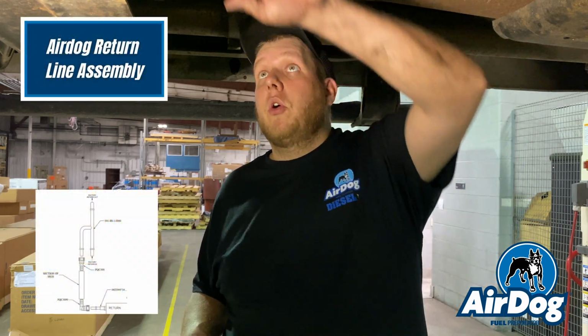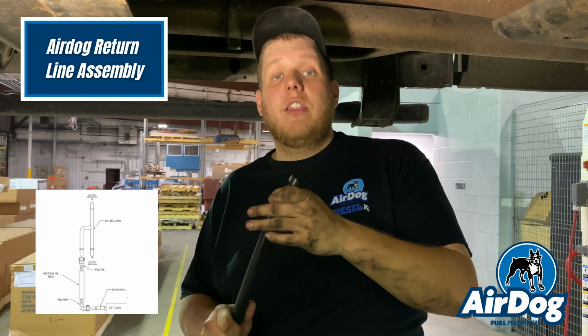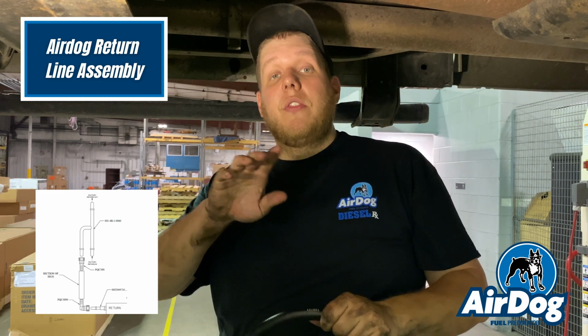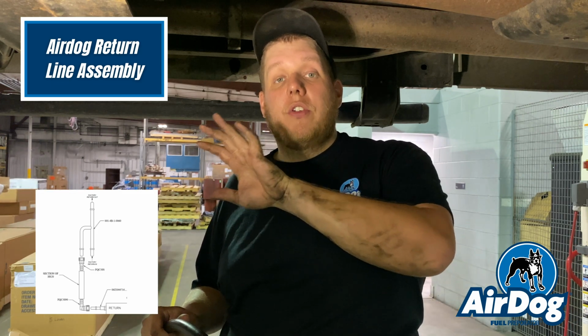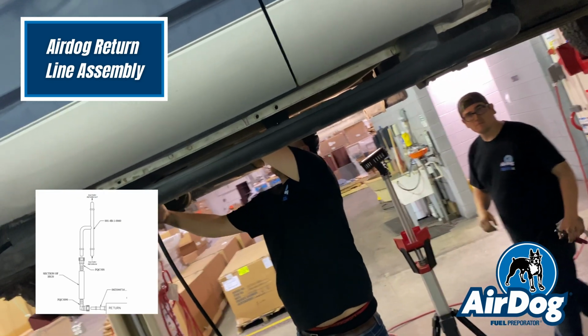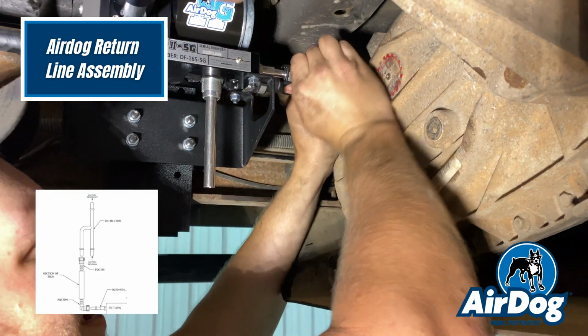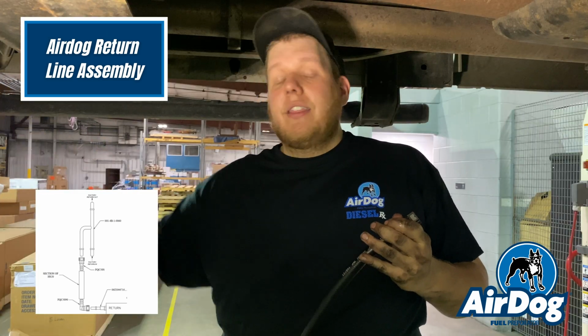So we're going to go ahead and assemble our Airdog return line. At your quick connect at the pump itself, we're going to press in a 3/8 straight fitting that's already pre-installed in this hose. And this hose is going to route up to your return Y that we installed off of your factory return fittings off of the factory lift pump. So I'm going to go ahead and route this through, connect it at the pump assembly, and then we'll get down to trimming the line at the return tee.